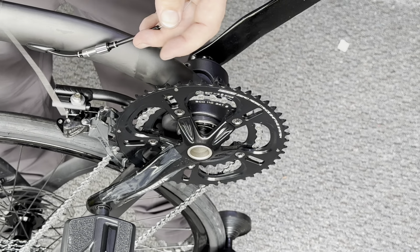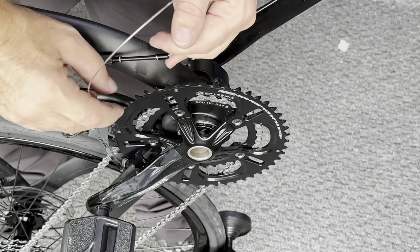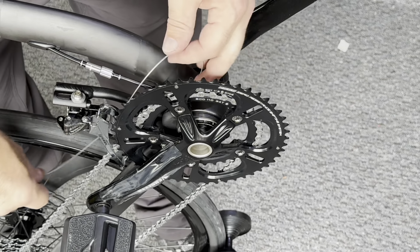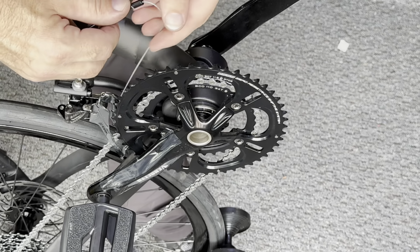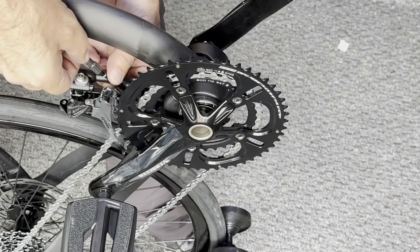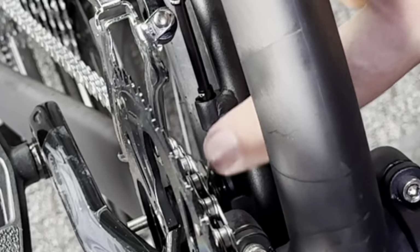And for your X seam, you will have a nice length of front housing that has a little bit of loop at the handlebars that matches the rest of the housing, and then this little section sticking out the front. And we're going to simply run this cable down inside around the pulley, and we're going to set the end of the cable into the cable stop right there.